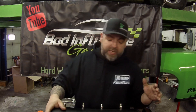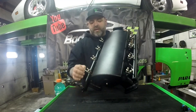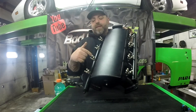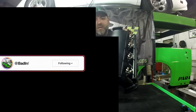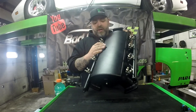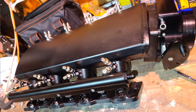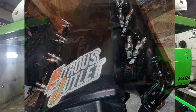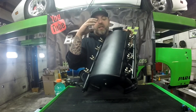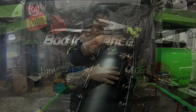We're putting a stall converter in it so it can get up in the power band. We are going to take this intake manifold — we've already done some of the plumbing. We drilled and tapped to 1/16 NPT and these are 90-degree nozzles, already pre-installed. I did this over the winter during downtime at my house. Now we need to mount the nitrous solenoids to the intake manifold and plumb it.